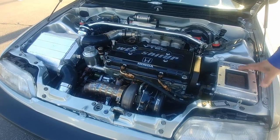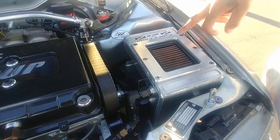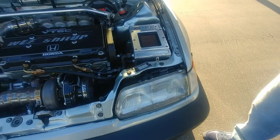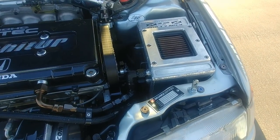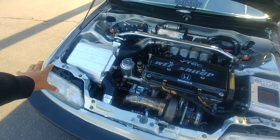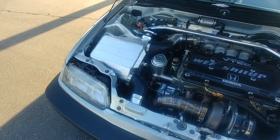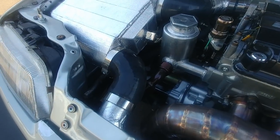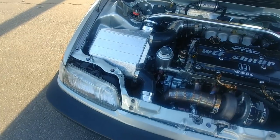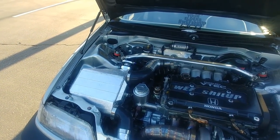This is my baby — this is my breather box, designed by Built to Apex strictly for me. A full CNC piece on top and the rest is just welded together. Super cool piece. Got to utilize every space we have, trying to keep everything up front. The battery's down there. It's got a Speed Factory full tucked radiator with dash-16 lines going up to the Speed Factory fuel pot with the Moroso cap. It's got a Moroso overflow radiator coolant tank, and that's my field tank for the water-to-air setup.